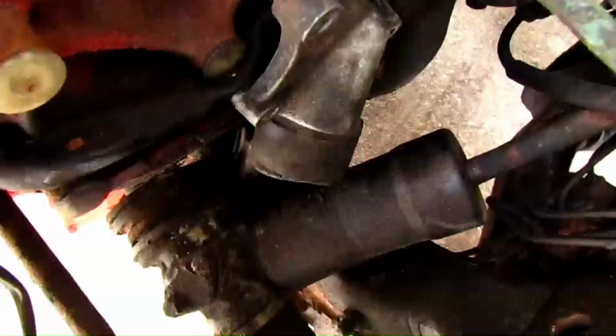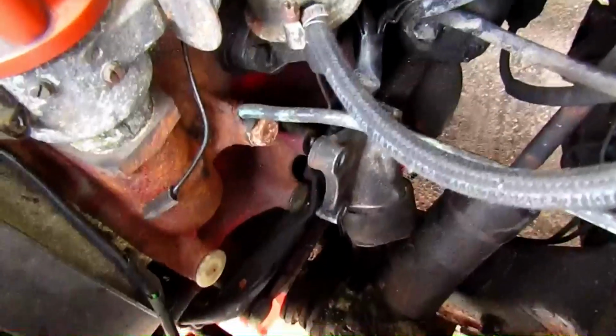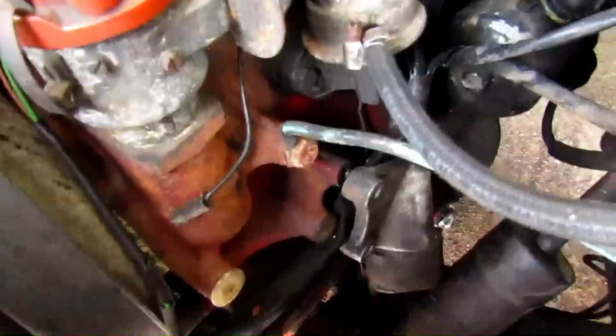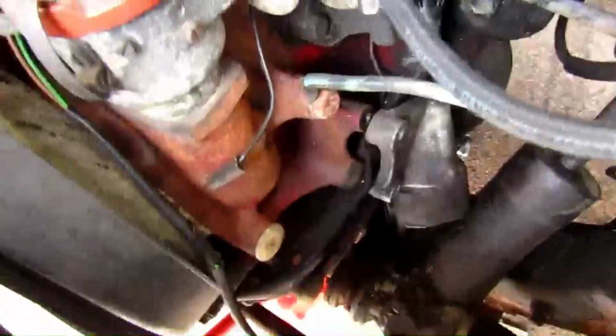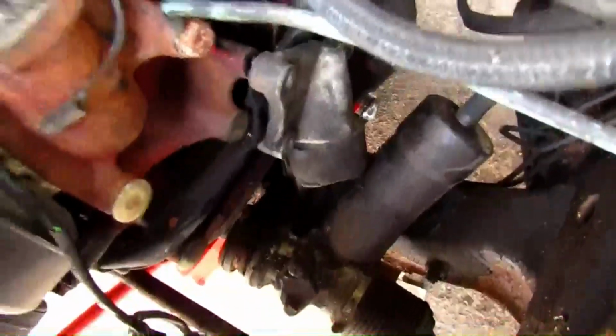So as I was showing you guys, to get that bolt out, I first undid this one, because then you have some wiggle room to get underneath that one. When you get this loose, just keep one hand on here and try to get some movement in the bolts, because if you don't, you have a chance of ruining your thread inside of the engine, because the weight is pushing against the plate. Otherwise the bolts will just be ripped out, and then it sucks, because then you need a new engine or new thread, or I don't know, but it costs money, so don't do that. I will be getting that one out, and then we can just take the other one out and see how it goes.